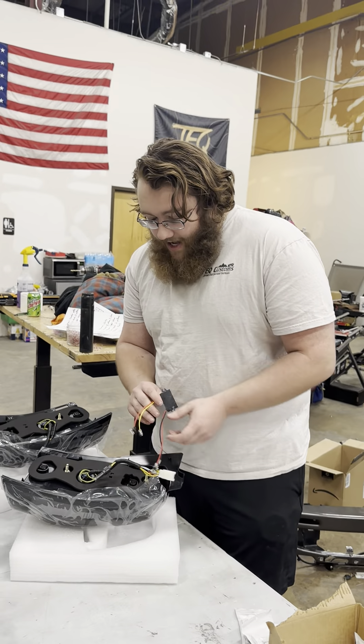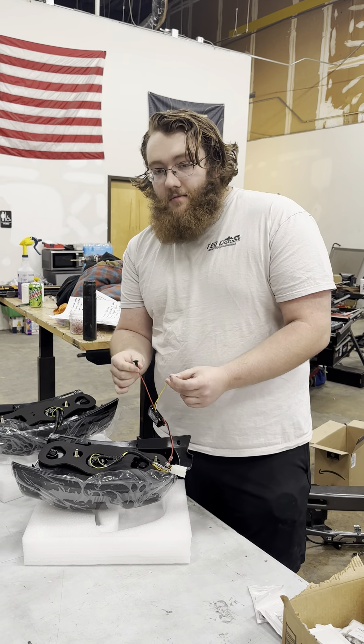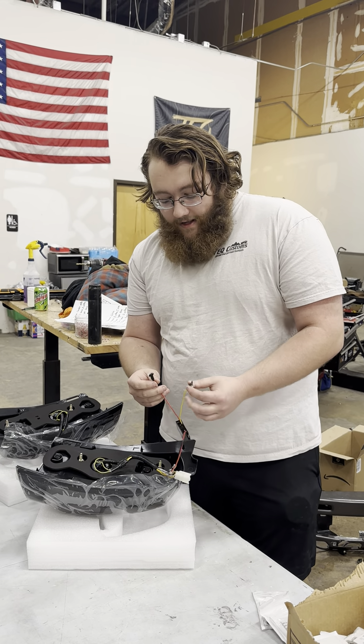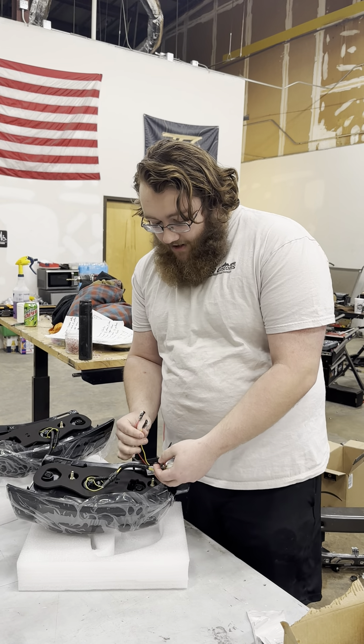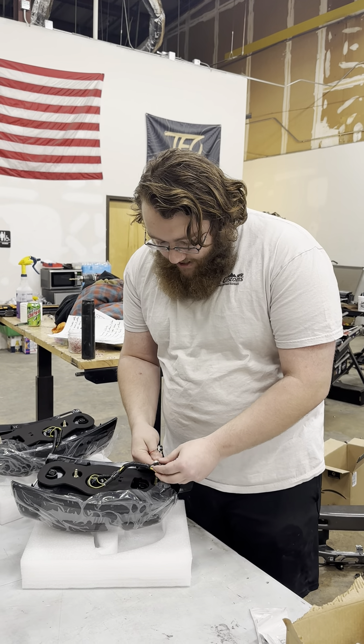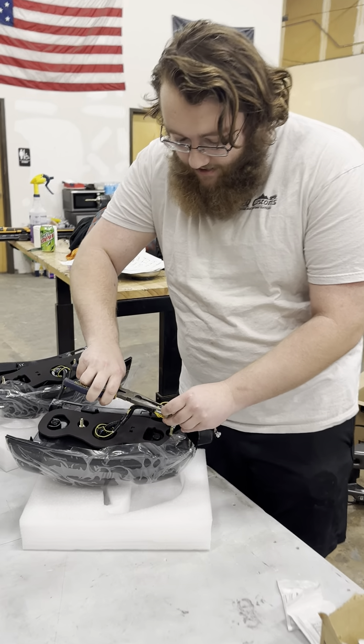On the outside, there is another red wire which is going to be the power out. The yellow wire is also going to be a ground for this side, so the yellow wire can go on that same black ground wire on the taillight harness.